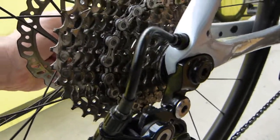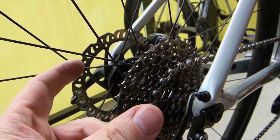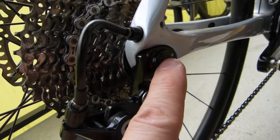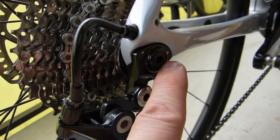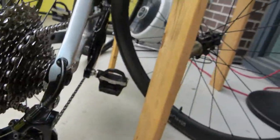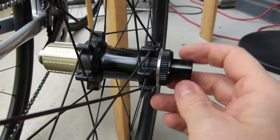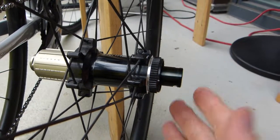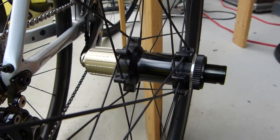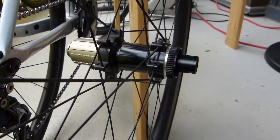Okay, so when it is tightened, the spacer to spacer distance must be 142 millimeters, and in that case the axle's end comes flush with this threaded surface. That's how it should look like. So pay attention to these spacers, and they simply just counter rotate and they finger tighten. Of course you can put a wrench on it, that's what the flat spots are for. So pay attention.